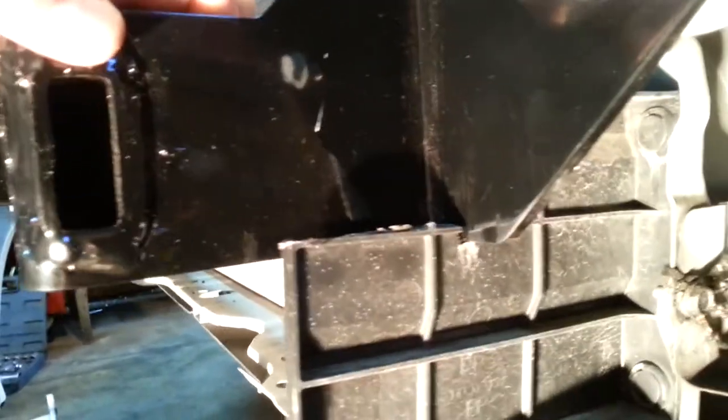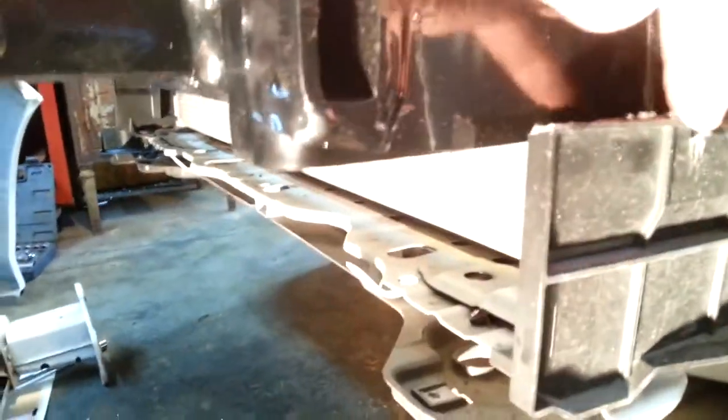Before I start putting this back together, I'm going to show you how I had to cut some plastic off this piece. Here's the old piece - it sat up here like this, so you cut that off. I notched the plastic so the metal bracket would fit in there and not stick out - same on this side too. Then the same way on the other side, there's another little small piece of plastic to cut out. I put a little notch in it - it kind of helps as you set this up, it'll sit in there and hold it steady as you get a couple bolts in.